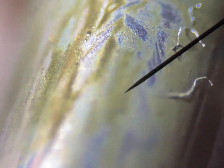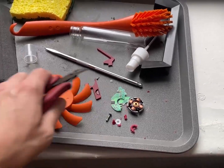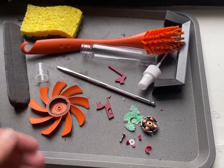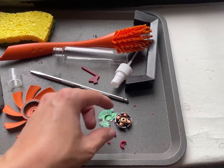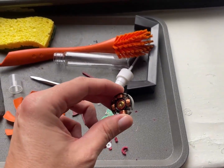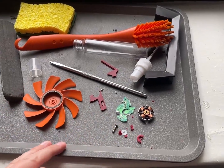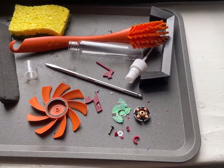That grease is baked — it's been cooked. Suffice to say that is a very cheap way to make a fan and you get away with it if you make the grease better, or the bearing — this is just a bushing. If you made that better it could be better, but if you cheapen out on that the whole thing is pointless and cooks itself in about three months.